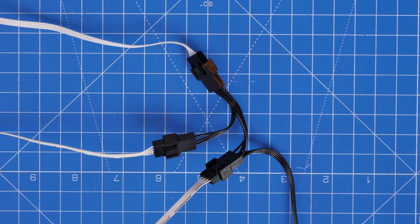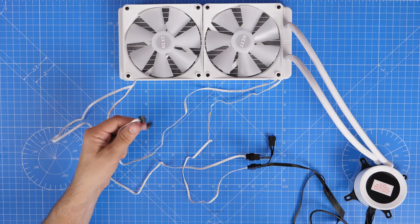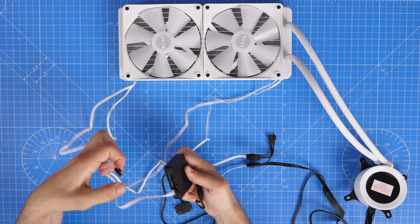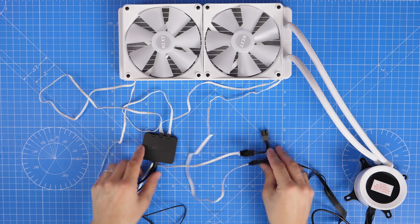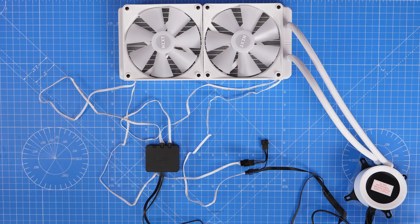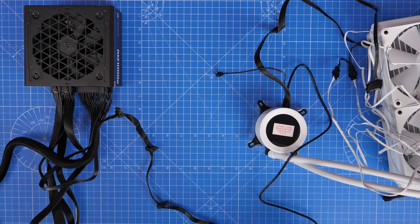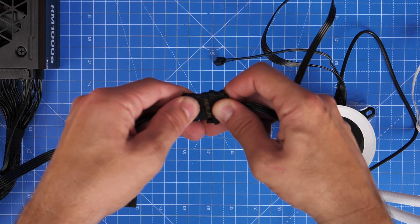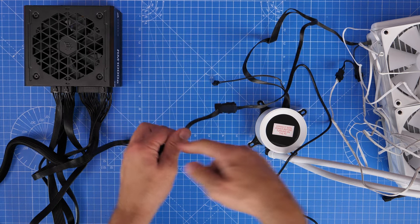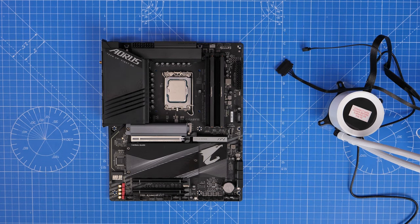This is a brilliant cooler — you can put GIFs on it, and it has a display showing both GPU and CPU temperatures at a glance. It's also a nice quiet pump with good cooling performance. For the basic wiring: RGB goes to the RGB controller, fan power goes to the pump head, and you need to make sure the pump is connected to the motherboard and to SATA power. That SATA connection is critical — without it the whole system won't run properly and your CPU will overheat.